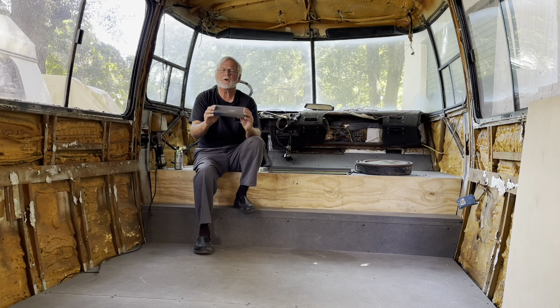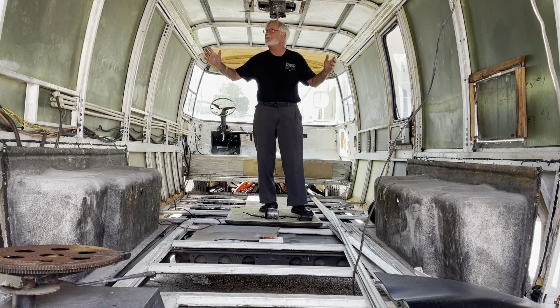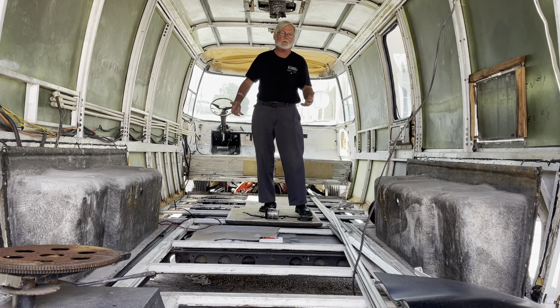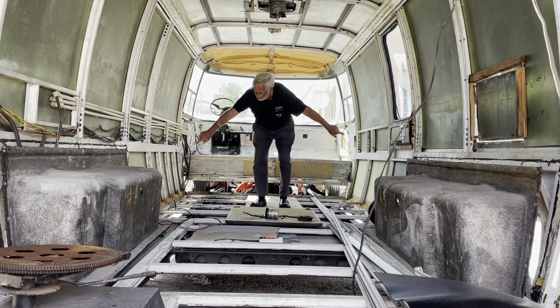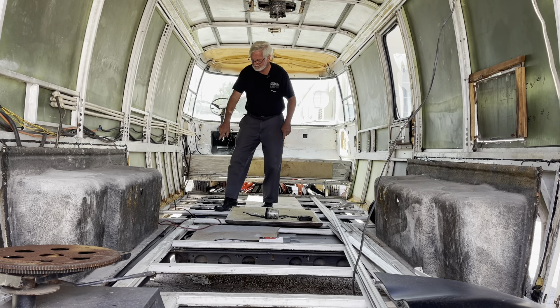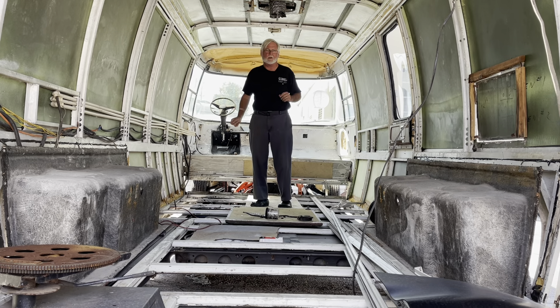Tensile strength is a really important part when you're talking about using it in the GMC Motorhome. This is the lightest, least damaging, highest tensile strength material we could find. So I want to show you why we went through all this trouble. Here we are. This coach is a trans mode, had no foam in it, and right now it has no floor — because the floor rotted out of it. The body weight is on the rails on the outside of the body, and the frame is sitting about 14 inches inboard.